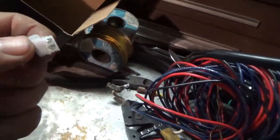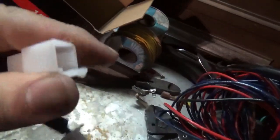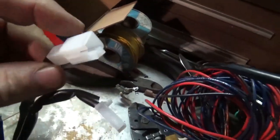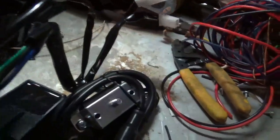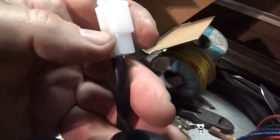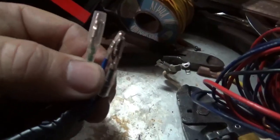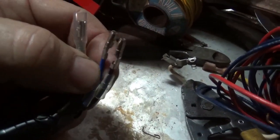You'll notice these connectors have green wires and a black wire with a white stripe. This is actually a pit bike wire harness — one of these would go to the key switch and the other would go to the handlebar kill switch. You know what you do with those? You ignore them. Don't cut them off, don't think about it. You're done with those.